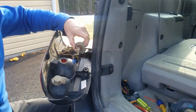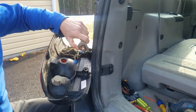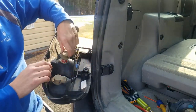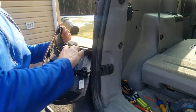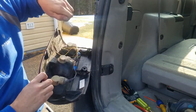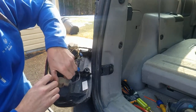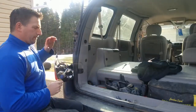We tested it and we have a signal — the turn signal is working! Now I'm going to put it back in. Insert the bulb, and we're going to lock it — rotate to the right to lock. To unlock, rotate to the left and it pops out. Insert, rotate right, and it locks in. We're good.